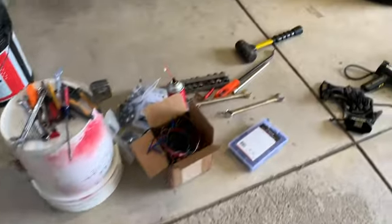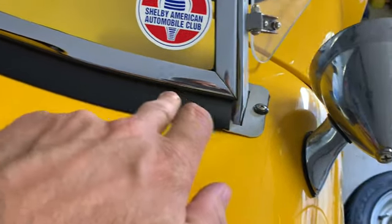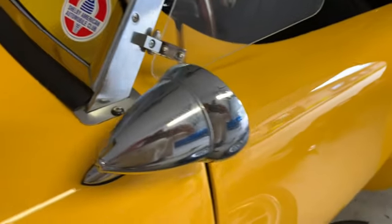From what I can tell, reaching my arm up under the dash, looking from inside, looking from outside, the dash seal is right about here, and then it's open all the way down the side to the bottom. My goal is to get something wedged back in there to fill in that gap, so that we can keep some of the heat out of this thing, because it's pretty hot. Looking in here, you can see that it's lit up from the light that I have on in the engine bay, and you can see where it all seeps through up there. That's what you see as bright light, and the underside of the body is all gap for hot air to come seeping through and cook me while I'm driving down the road.